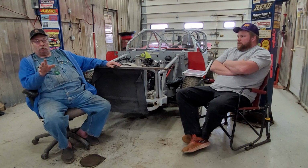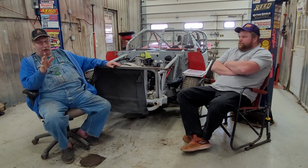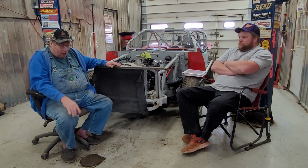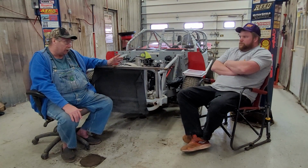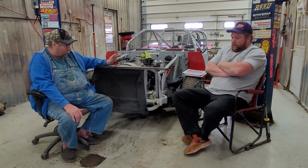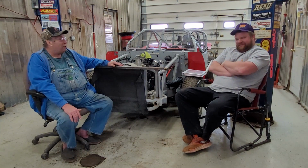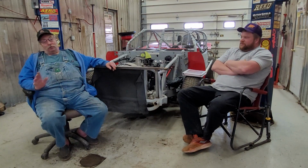We had trouble chasing the jetting, chasing carburation, and breaking up. Some of you noticed that during that feature win, which was the second time we raced it, the engine was breaking up. We were 20-25% down on horsepower, and it managed to keep ahead of the second place car, which is a good thing. And got lucky. Yeah, you can't count on that. No.